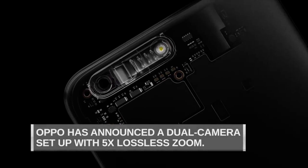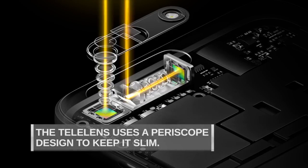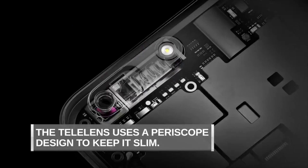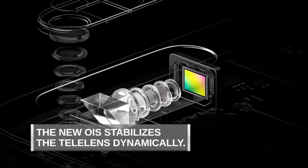The camera sensor is actually pointing sideways. It's receiving all of the light you're looking at via a prism that bounces at a 90 degree angle. So that extra long lens that can zoom in is put in the phone horizontally and then reflecting outward. In that way, you could actually have optical zoom on a smartphone, which I think is pretty revolutionary.